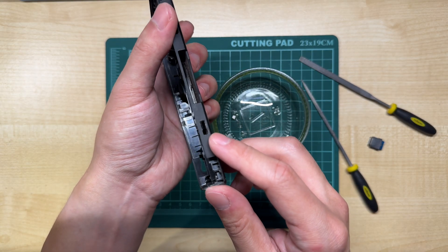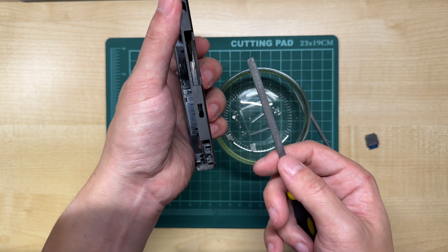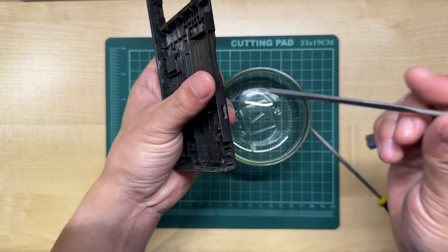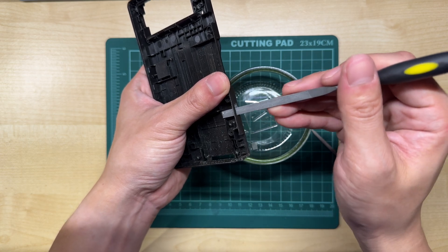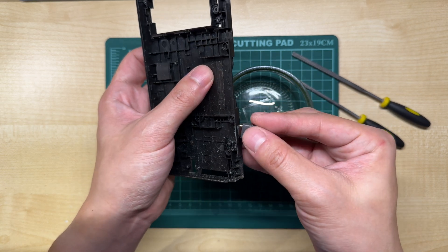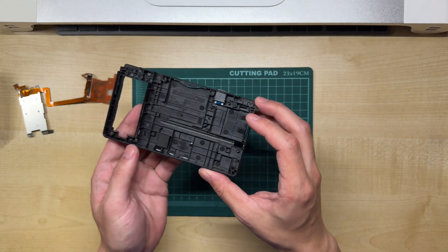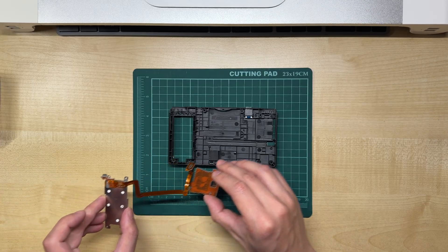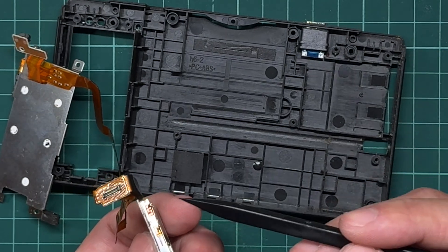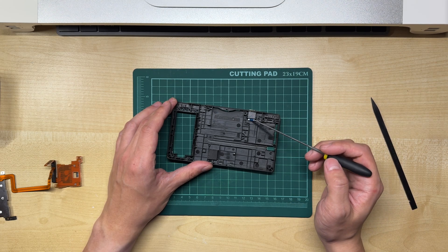Eventually you'll be able to join the two holes with the file. However, at this point the hole might not be the right size or shape to fit the USB-C port. In which case, you can smoothen out the longer edges and heighten the gap using a flat edge file, while also elongating the gap using a rounded edge file. Throughout this process, make sure to constantly test the fit of the USB port. Initially it might be easier to test from the outside, but once the hole is the right shape and size, we can start fitting internally. You'll reach a point where the USB-C port can fit snugly within the slot. Also make sure to test the fit with the SD card reader — one of the most common issues is the corner of this board coming into contact with the corner of the SD card reader, in which case you'll need to file down more material from the casing or remove some material from the board itself.